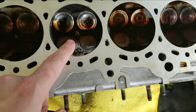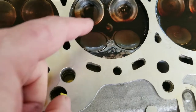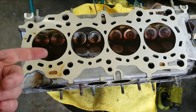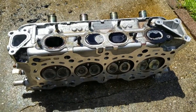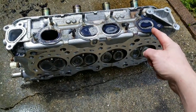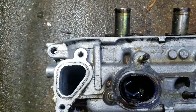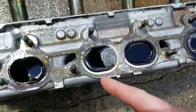After about an hour, it seems that one chamber is low while the rest are still full. It could be the spark plug, and hopefully that's what it is. As suspected, it was leaking out of the spark plug tube. I also decided to pour some degreaser down into another one that has some type of port — it leaks out the bottom, I think it's part of the EGR system. We're going to try to soak and clean those out as much as we can.